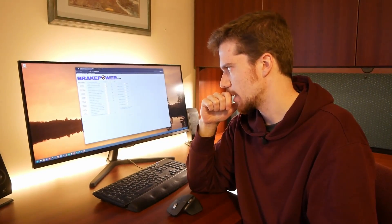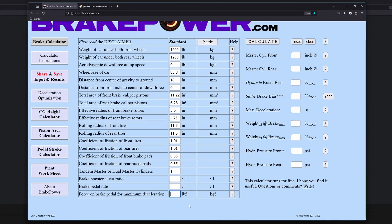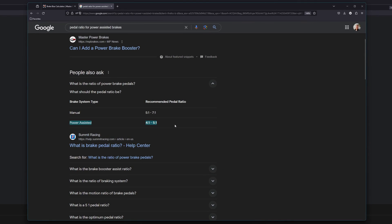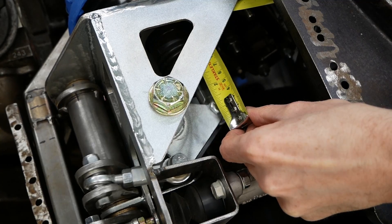These last three items are what we don't know yet. The booster assist ratio depends on having a pedal ratio, and that also goes for the force required. The internet says a 5 to 1 pedal ratio should be about right for a power-assisted car like ours. Like the clutch, we really only want five inches of total leg travel, and in order to keep at least one inch of movement at the master so it will displace enough fluid, it looks like 5 to 1 is a good starting point. Even though we're still missing two boxes, we can still hit calculate now to get some helpful info, and almost everything is now populated and locked in based on the rest of our data, with the two remaining items being the front and rear master sizes.